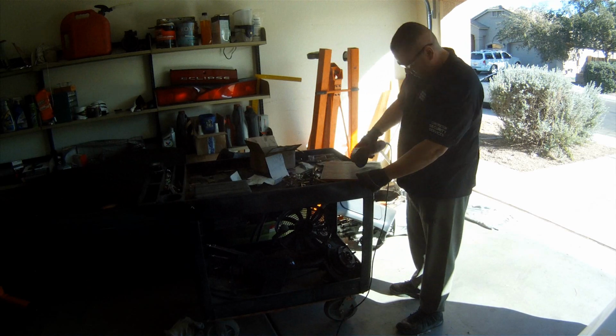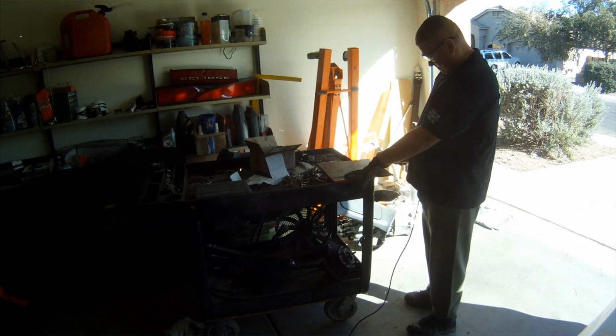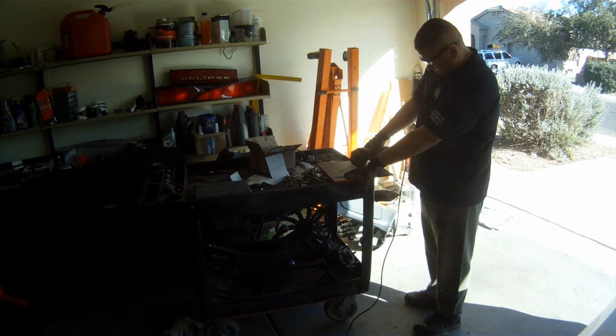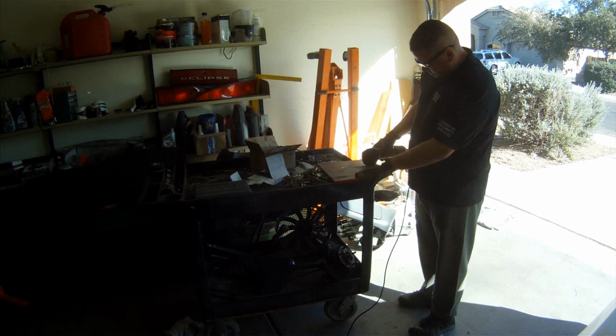That way I can use the cheap Chevy motor mounts, which you can get anywhere super cheap, and just have a set of braces that weld from this bracket to those cups. The cups are about 4 inches wide, so the motor mounts are big enough to handle the power, no problem. Figuring the V8s are usually in these.